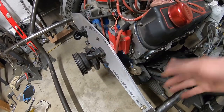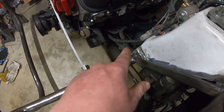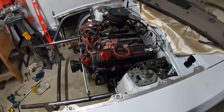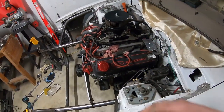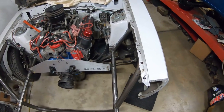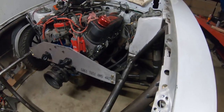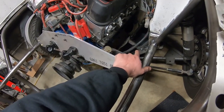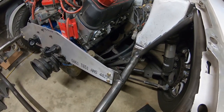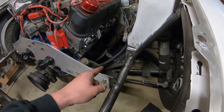With the K-member out there you've got tons of access to your oil pan and stuff like that. I saw a stiletto rack at my buddy's shop — the whole rack body couldn't have been bigger than the valve cover, it was really little. Then you'd need to lengthen the steering shaft, you'd pretty much just need the middle bar and new tie rod ends. But I kind of hate cutting up good stuff. So I can't decide — cut that off, or buy a new chromoly K-member and just swap all my other stuff over.